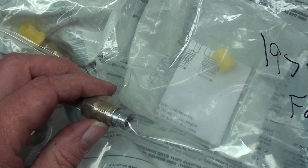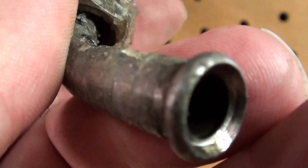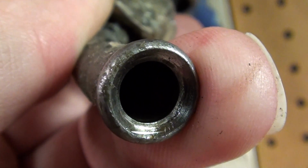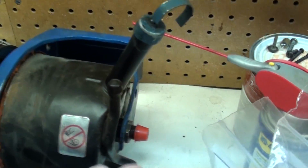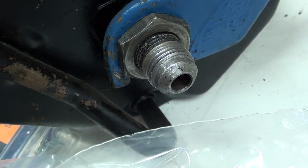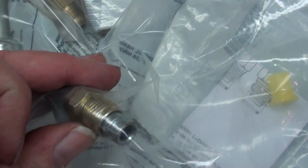But with this pump, look at that connection. They use an O-ring seal to seal it up compared to a compression fit. And look at this. Is it gonna focus? Let's see. Well, as you can see in there, on that 45 degree angle, there is damage. That's what happens when you put it on a fitting like this, and if it's not perfectly smooth, there's going to be damage on your pressure hose fitting. So, to avoid that, you go with an O-ring seal type of fitting to your power steering pump.